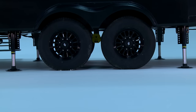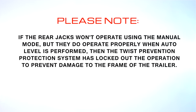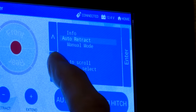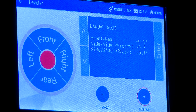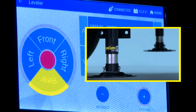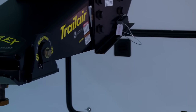Please note that the middle jacks, if equipped, operate in conjunction with the rear jacks. If the rear jacks won't operate using manual mode but do operate properly when auto level is performed, then the twist prevention protection system has locked out the operation to prevent damage to the frame of the trailer. If the auto level sequence does not perform as described, place the system in manual mode and test that the jacks operate correctly by pushing their coordinating buttons on the OCTP individually. The front button will operate the landing gear, the rear button will operate the rear jacks, left will operate left, and right will operate right.